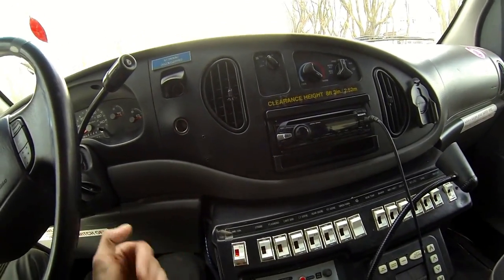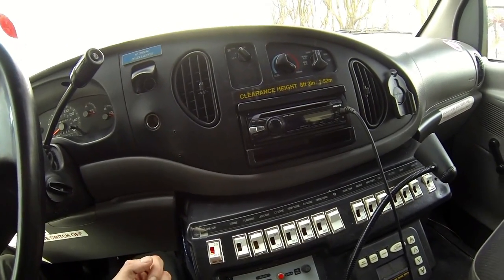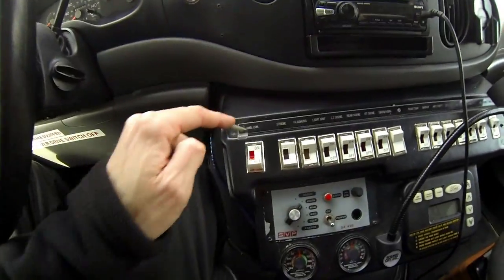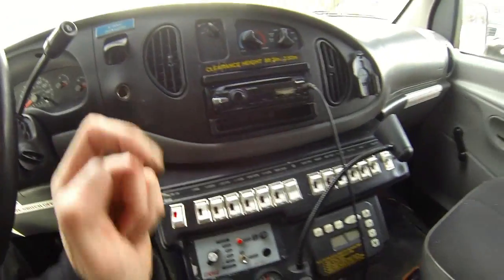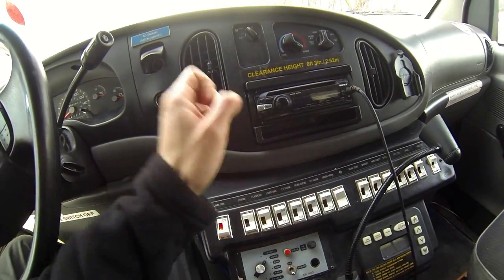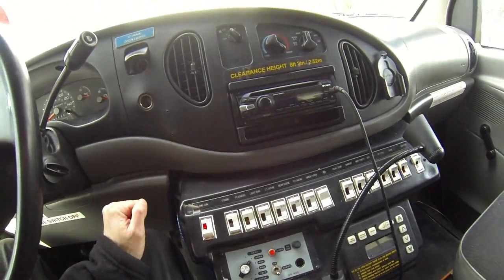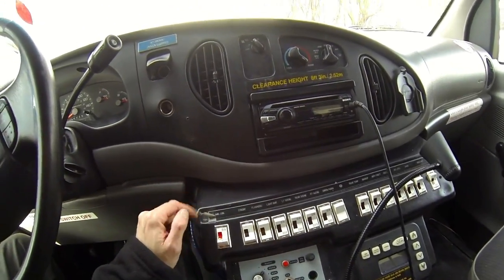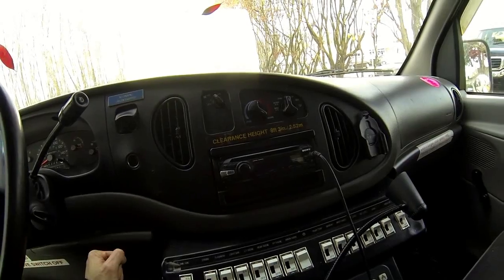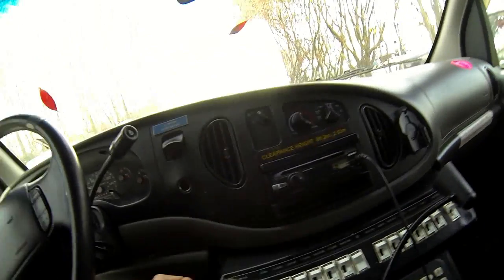The stereo is on the front battery, but the wiring I have in the back for the subwoofer — there's no subwoofer in here because I only used my own subwoofer from the motorhome and connected it up when needed. But the wiring is there, so if you're going to put a subwoofer onto the amp in the back, it will not turn on unless the ambulance connect is on because it's connected to the rear battery. If that's off, you'll just have the regular speakers. The front door speakers were disconnected and the wires were run up to the speakers outside on the roof on the left and right side.